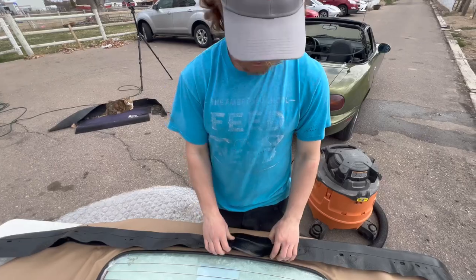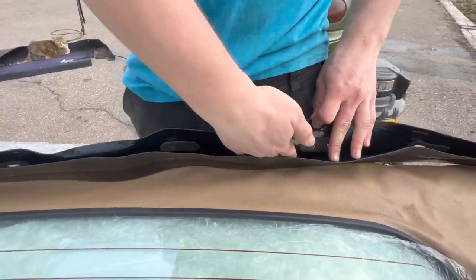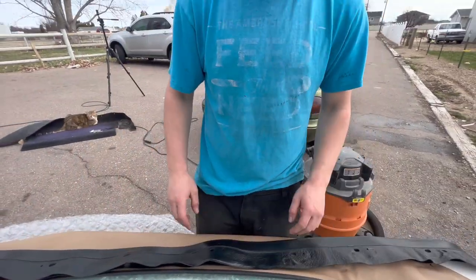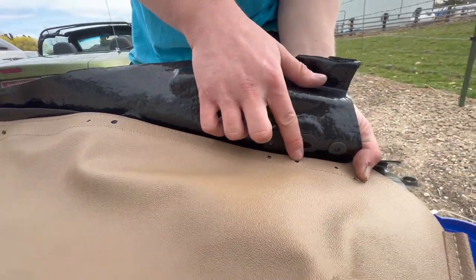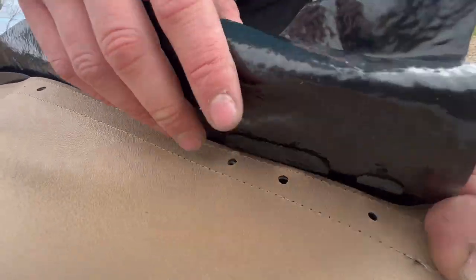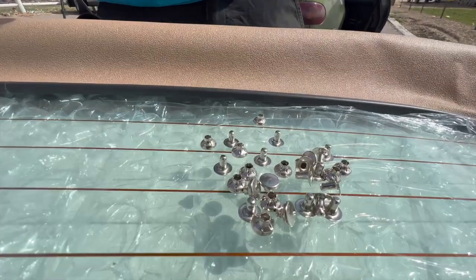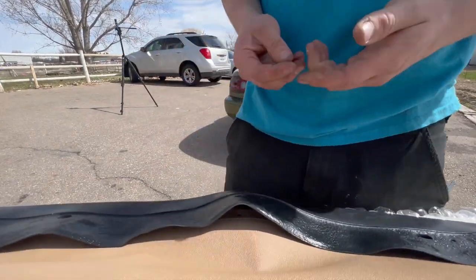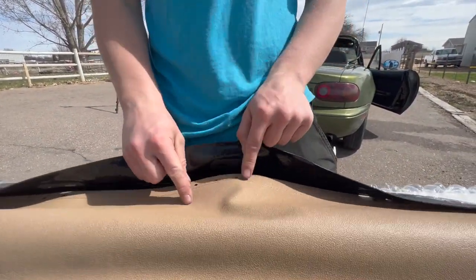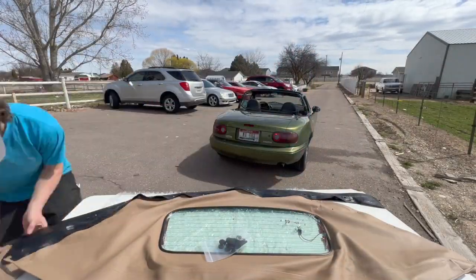The rain rail is directional — we want the larger, rubbery side out towards the back of the car, and then the top is going to get sandwiched in between these two sections. You can see all of our holes line up, which is good. This hole's for the stud that actually has the 10-millimeter nut, and these two are for the rivets. We're going to go ahead and use these little speed rivets just to make it a little easier when we're installing it into the car. The center hole is for the stud, so you want to make sure you're not putting the rivet through the wrong hole or else you're going to have to drill it out.